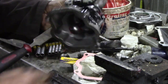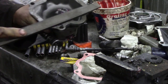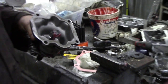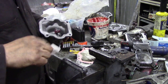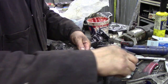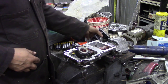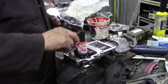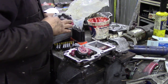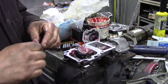Found the gasket for this bit. Just go across the top - this is a paper gasket, so we want the faces to be almost right. It is a Land Rover after all, so it has to be almost right. Oh, that looks nice - that's all right now. What we're going to do is fill this full of grease, and the reason for that is it will protect everything.